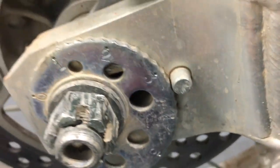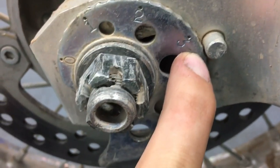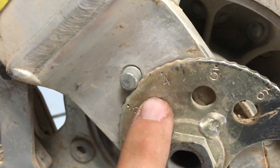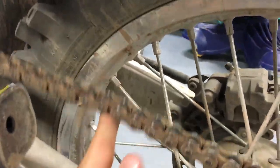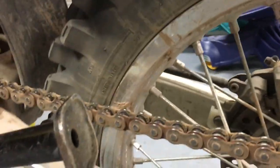You've got to match them on each side. So right here I've got three — you got the bump there, bump there — so two bumps away from number three. I'll come over here and do the same thing: bump, three, bump. Before it was down here, so it was just a little bit too loose. That's about as much slack as you're going to want. Even this is considered a bit tight, oh well.